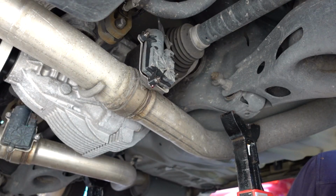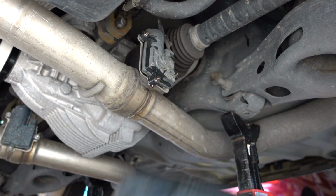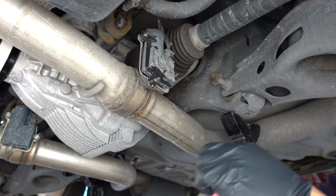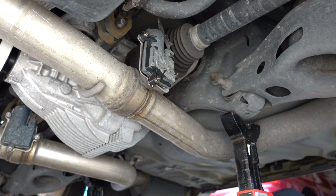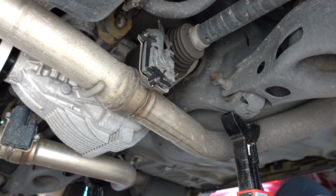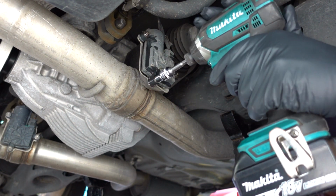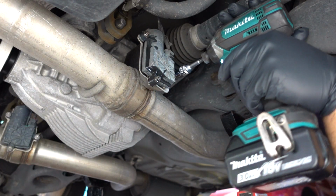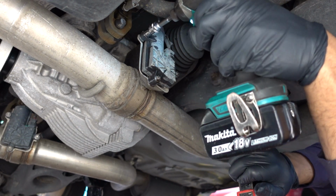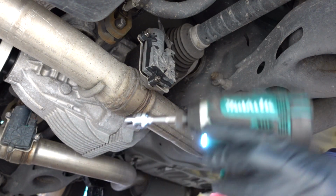Okay, smaller. Now, I don't recommend people taking this particular approach, but figure out what size it is. Sometimes I find that these things are super particular and they want to pop and break, especially exhaust parts. So I like to take an impact and give it just a little tap, because then it's equal on all sides instead of leveraged force. And there we go. All right.